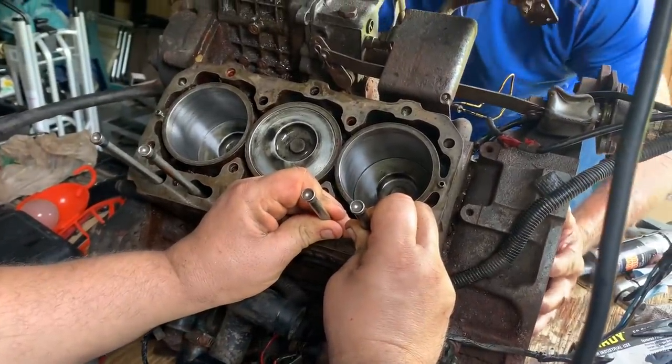So the little tappets down there for the push rods, they were rusted in place. This one I haven't freed up yet, but I've just been spraying them with some lubricating oil and then using a quarter inch drive extension. Yeah, see how nasty that is? But this is the one I've already got. All of these are moving already and cleaned up, so it's just a matter of getting them lubricated and moving. I'm going over here and I'm just gonna make sure that these are all working now.